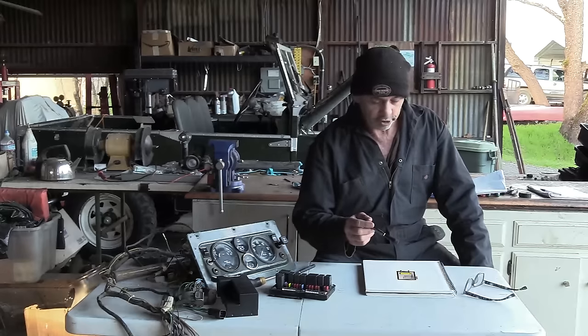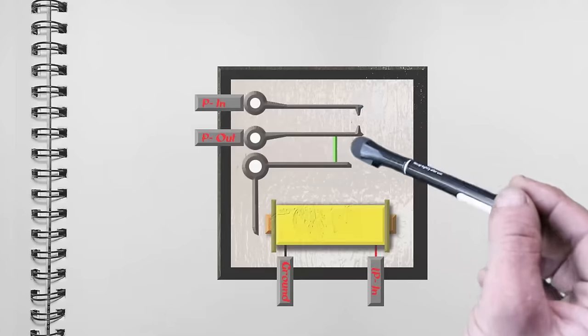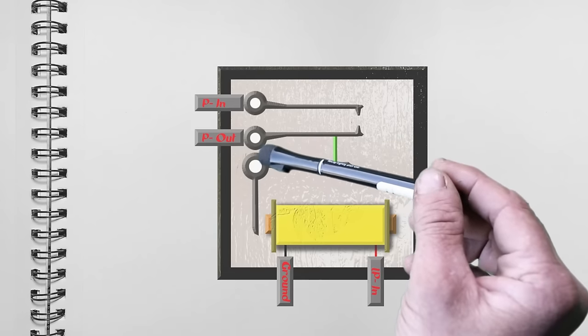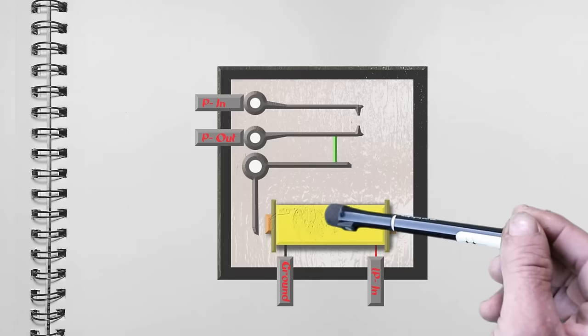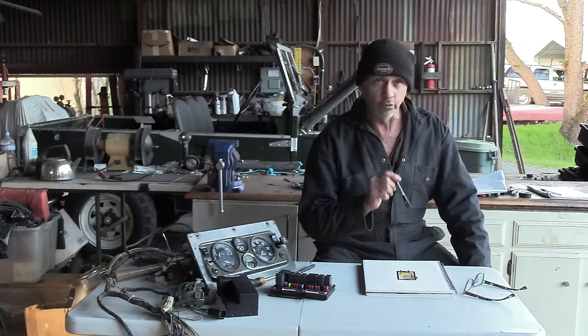So we have a closer inspection of the internals of our standard 4-pin relay. We'll see two pincers there, and one of them is connected to an armature via an insulated link. And this thing here represents a conductor wrapped in copper wire. And if we were to run a small amount of current through that, it creates a thing called an electromagnetic field. That sort of talk would get us dunked in the river in medieval England with people calling us witches.